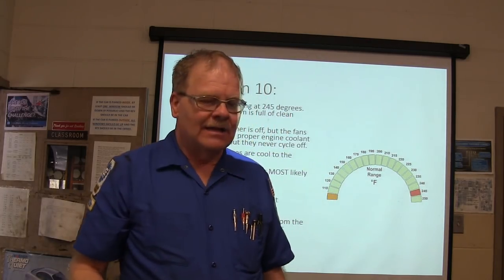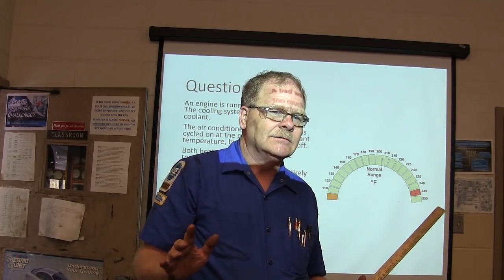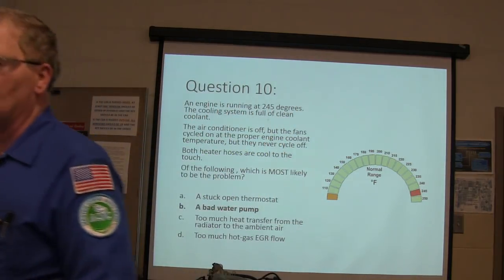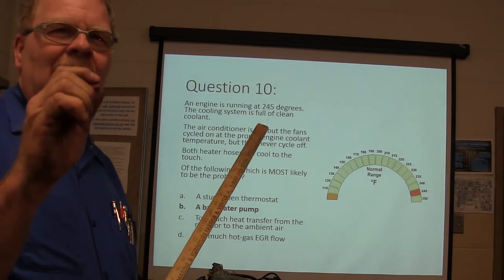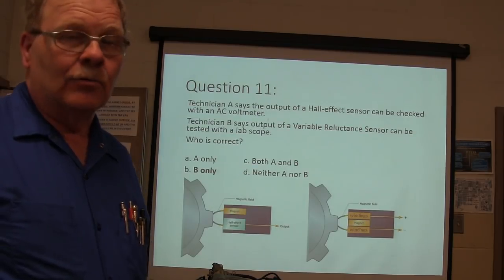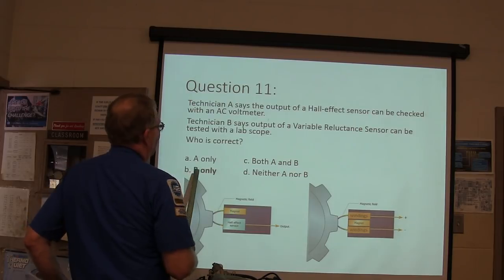If it's not moving, I have seen them where the car wasn't running hot, but she didn't have any heat. When we did that, we found out there was no coolant going over. It's really amazing. There's a water pump over here, I'd have to find it, where the impeller is rusted to the point where there's nearly a quarter of an inch space between the tip of those impeller blades and the reaction surface. And it just wasn't pumping. It's cavitating.